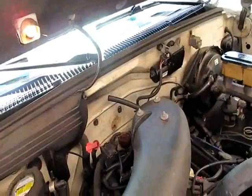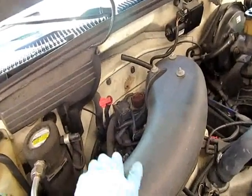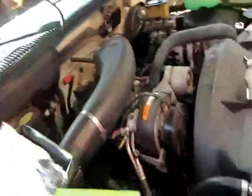Why is it rusty? Moisture. 100% humidity all the time. What I'm gonna do to keep the iron dust from getting inside that distributor - I'm gonna put a piece of aluminum foil over it, cut a hole around it, and then wire wheel that whole shaft. Then I'm gonna put a little dielectric grease on it so hopefully that will prevent it from rusting. It'll probably last a couple years. Always keep a piece of aluminum foil around - anytime you're doing grinding or want to cover things quick. Actually I could just tape around it, that'll be easier. Use masking tape.